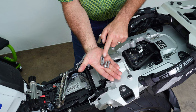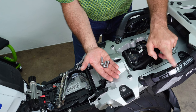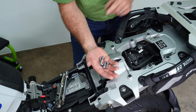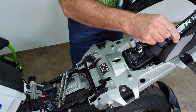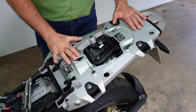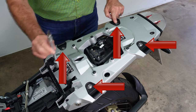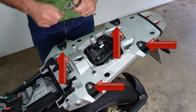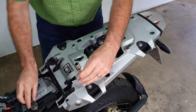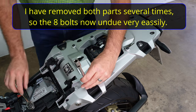Bear in mind the long bolts go on the front of the grab handle. Don't get that wrong — long ones in the front — and then the rack assembly just lifts straight off the bike. Moving on to the silver-grey panel underneath, you can clearly see the four bolts — again TX40. When you first take them out they'll be hard to undo, but once loose they come out easily. Take all four bolts out and lift this panel straight off.